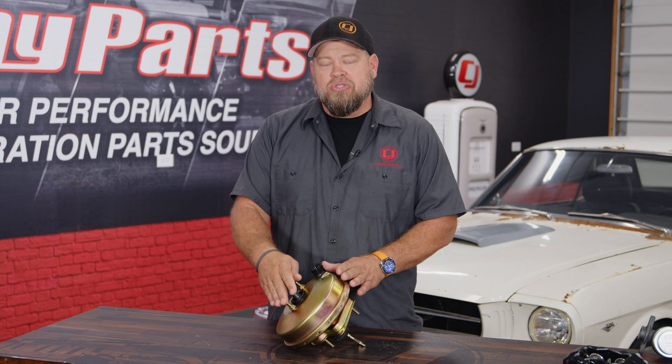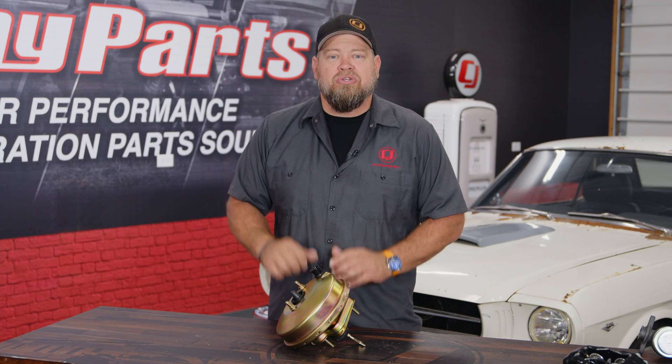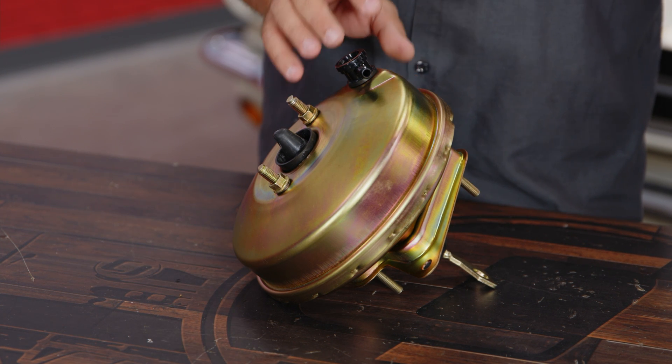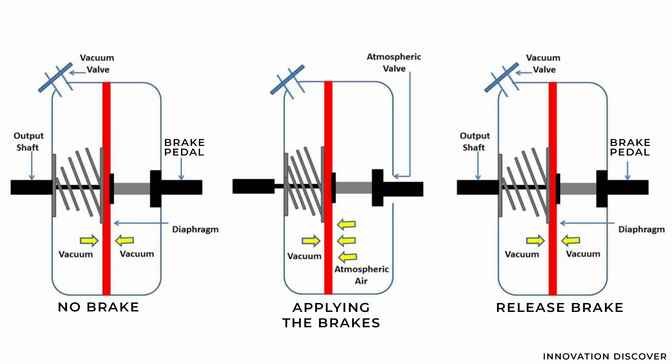When we put pressure on the pedal, it pushes the push rod into the master cylinder, which forces the fluid out through the lines and ends up at the calipers. As you saw, it is very difficult to push in that push rod. The angle of the brake pedal makes it easier, but even easier would be power brakes. Power brakes add a vacuum booster that mounts on the firewall, and the master cylinder mounts to the booster with the push rod still going through. This uses the vacuum off the engine to make the brake pedal a lot easier to push. This check valve connects to the intake manifold and creates partial vacuum inside the booster on both sides of the diaphragm. When you hit the brake pedal, the rod cracks open a valve allowing air to enter one side of the diaphragm while sealing off the vacuum, increasing pressure on that side and helping the push rod push the master cylinder much, much easier.